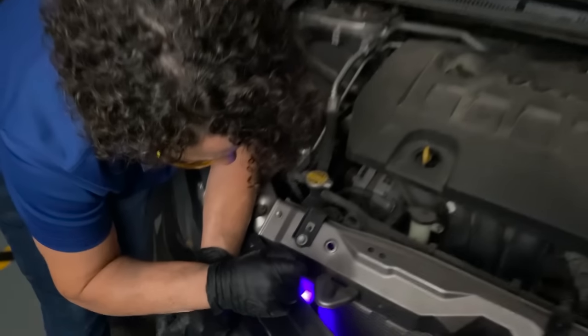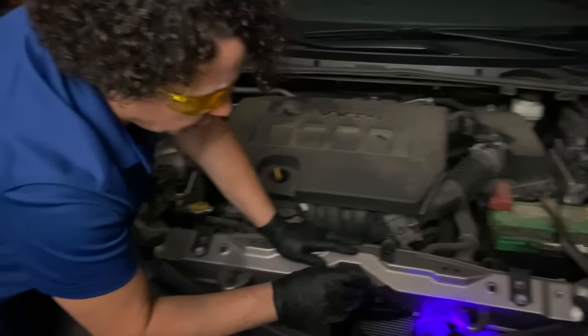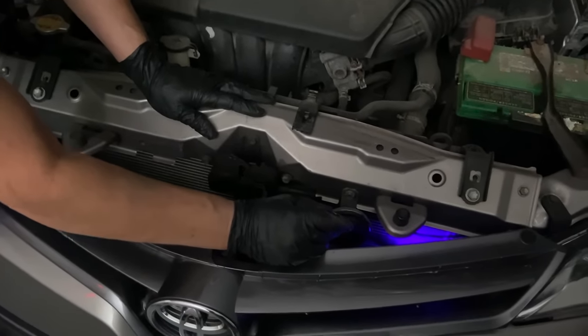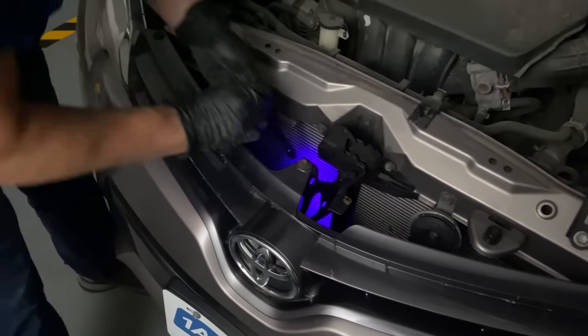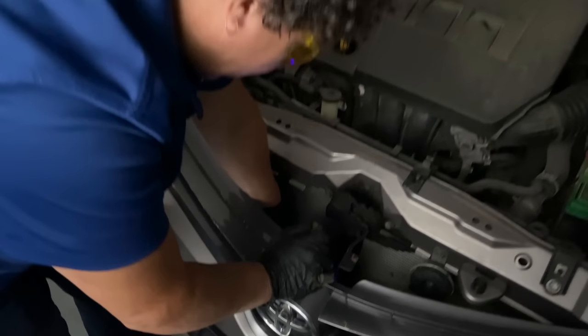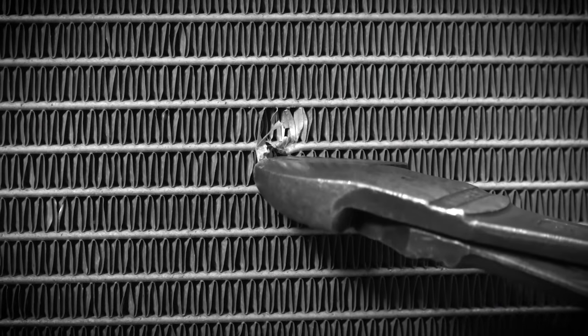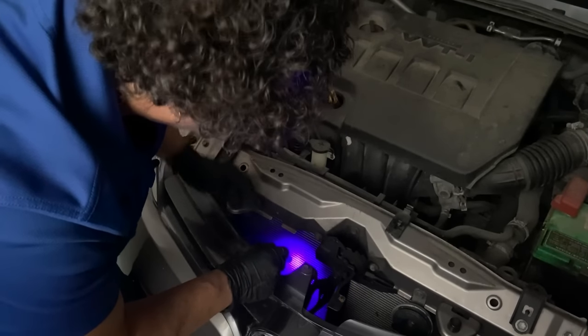Look at that — that's pretty green there. It could be an O-ring, but don't just put parts in that you don't need. If this car was a 2015 and it's now 2022, that's seven years old. This condenser has a receiver dryer on the other end — it's part of the whole unit, attached to it. That should be changed at a minimum of every five years. You can also see there are always rotted fins — bugs or rocks hit these delicate aluminum fins and they just get cracked, all the Freon comes out. If it has dye in it, you'll see a big green spot.